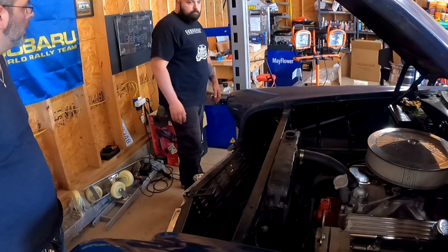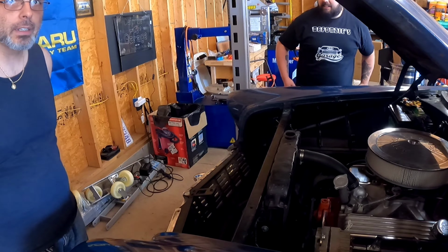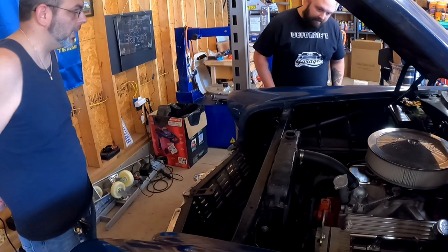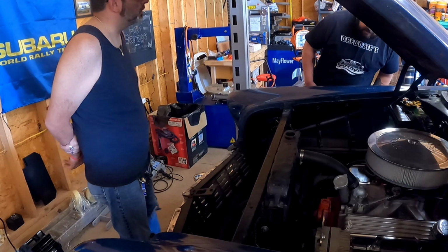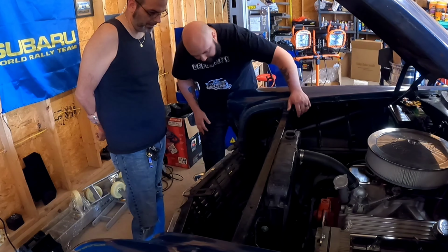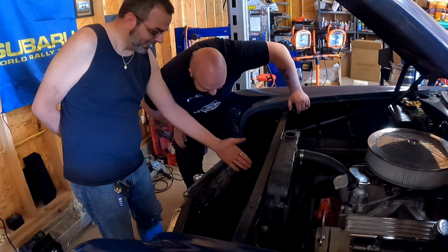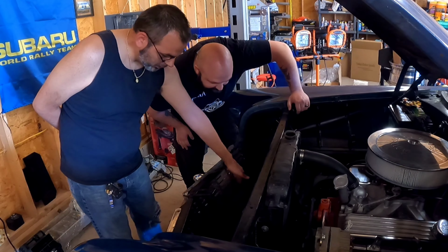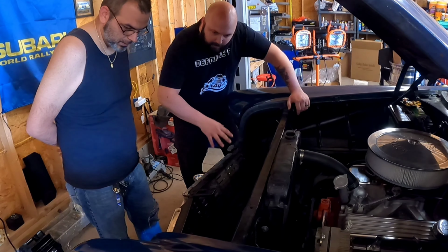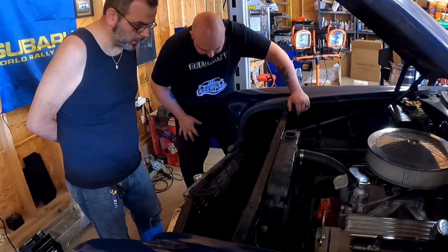You didn't explain about the petcock. Do you want to talk about the petcock? Yeah. So when you have a petcock, if you don't want to take the bottom hose off, most radiators have one. You twist that petcock, and it's supposed to drain the radiator. We're not going to do that though, are we? I don't think so. Oh, it does have the petcock. It's right here. So the antifreeze can pour into this scoop thing here and then just drain all over the place. The scoop thing, aka where all the tools are. Yes, tool chute. Got it. Okay, petcock 101. Here we go.